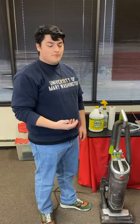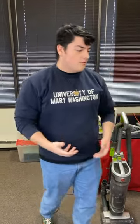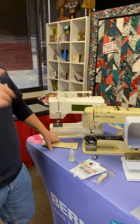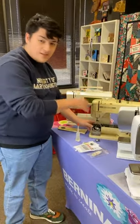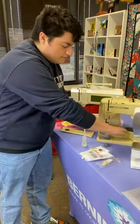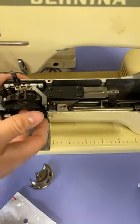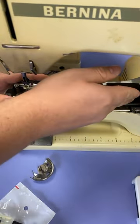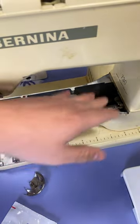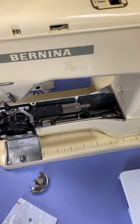As for tools not to use, that would be compressed air. We do use a compressed air machine in the shop, but when we do, we have all the covers off. Whereas if you're doing it at home, you're just shooting air into the machine to clean it out. You can think of it like a tunnel — you're just sending the dust and lint deeper in, and I've found pins and broken needles deeper in a machine, which could cause problems.